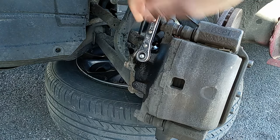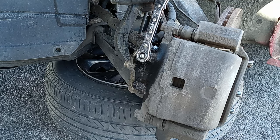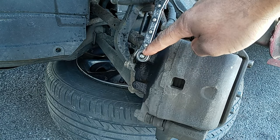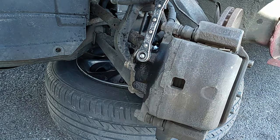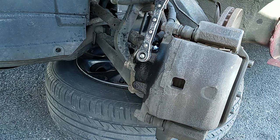I'm going to put the tool on now. You want to tell the person in the driver seat to pump the brakes three to six times and pressurize the brakes — push down to the floor and don't move your foot. Because when you release the bleeder screw, the person's foot is going to go down so that the air gets expelled out. You need a piece of cloth just in case — usually I just spread a piece of cloth and throw it away when I finish.